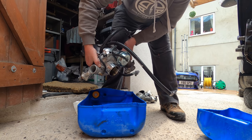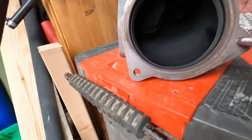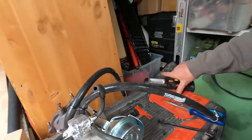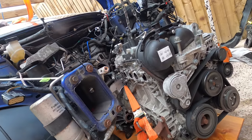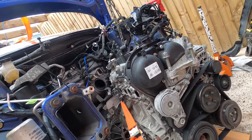You shouldn't really be pouring oil out of your turbo like that — it's just what it's sucked in from the cylinders. Everything with the turbo looks fine: the blades are fine, the intake shows no damage other than plenty of oil. I think it's okay. Now I really have to get this head off and see what's going on, but I'm going to strip a lot off and not film all of it. I may even be cutting belts off and hacking my way through because the engine is dead so I can't do any more damage. Not going to worry about bolt sequences too much.